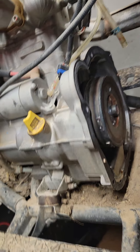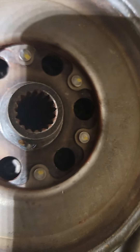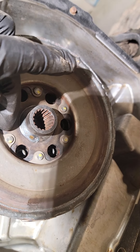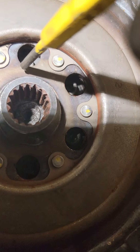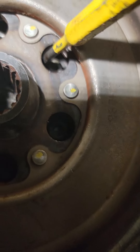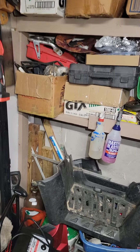There's your coupler. If you got a 550 and it's like this one, it's got these little allen head bolts in here — see all these little allen head bolts. Just move this around, take your little screwdriver. There's little bolts in there — just move this thing around like this, back it around. This thing will move. Put some Loctite on it. Anyway, that thing breaks — if I have another one around here I'll show you, that thing breaks.